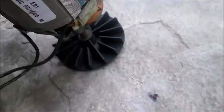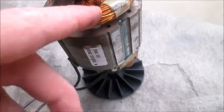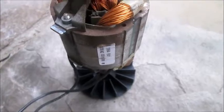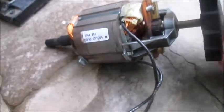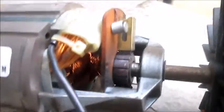This is heavy — really heavy. On some of these, they'll actually dip the motor into a varnish, and basically what it does is it makes these coils one solid unit instead of a bunch of strands of wire — it turns it into one solid unit, makes it much more rigid. So back there, that's what we call a commutator and the brushes.